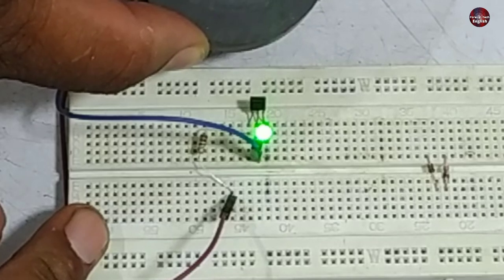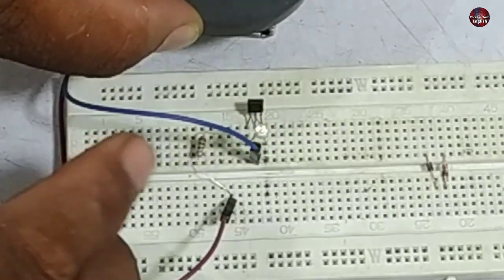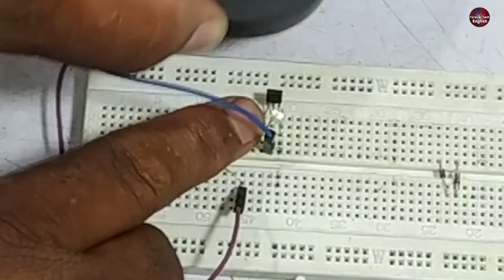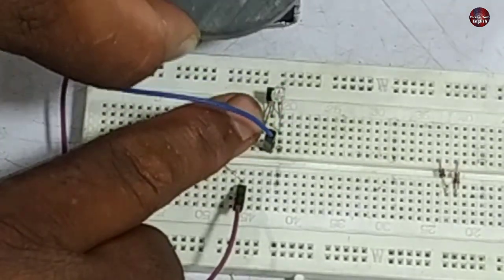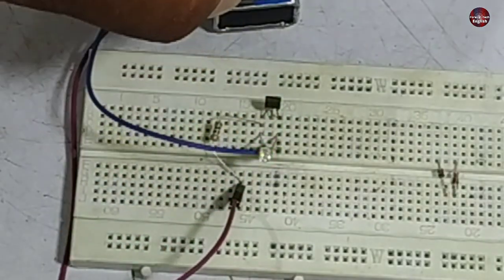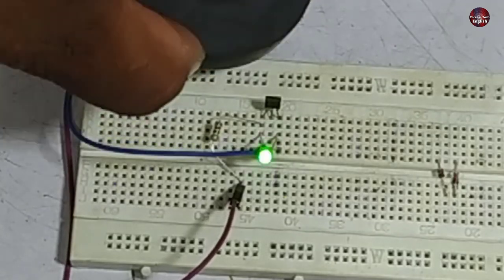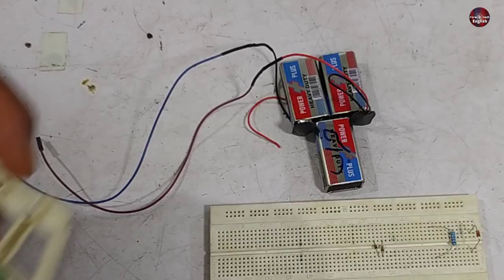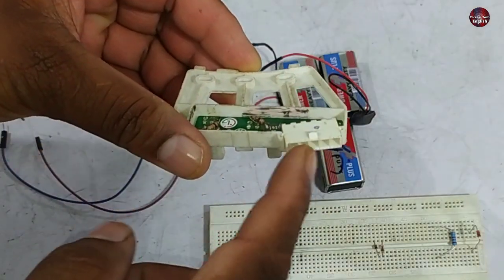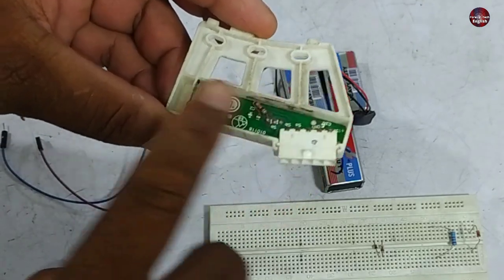This is how the hall sensor works — as the magnet comes near the sensor, the LED light turns on, but when I move it away, the light turns off. Similarly, it works the same in the washer. But inside the washer, this sensor works rapidly, as the magnets rotate and the hall sensor works the same way. You can check the hall sensor by removing it from the body of the sensor, so you will easily be able to test it and know whether your sensor is bad or not.